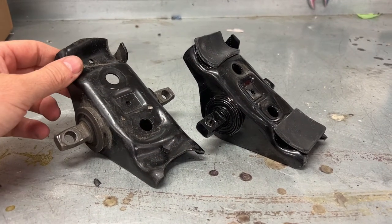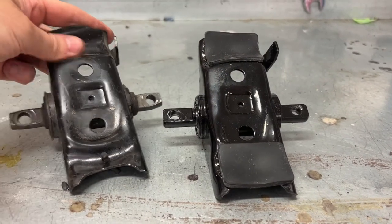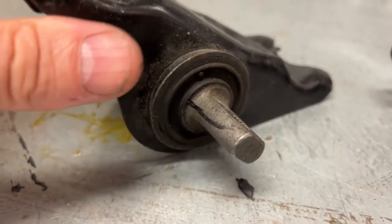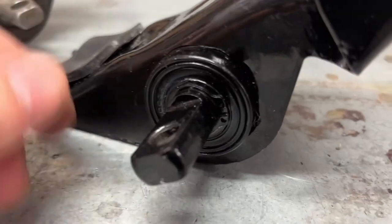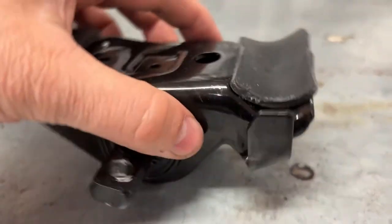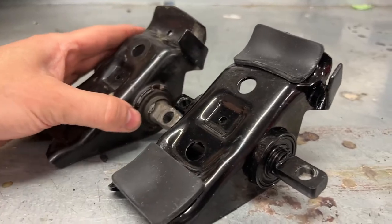In this video I will not install the regular stock ones. Instead, I purchased from opentrackerracing.com spring perches with rollerball bearings. This is recommended when you use a higher rate spring, since it will apply more force to the bottom end — it's important to have something that can move freely and without friction. Here we have the stock one on the left, which has a solid rubber bushing that doesn't move at all. Here's the rollerball bearing — no problem to turn it around. I don't understand why Ford didn't do this from the beginning.